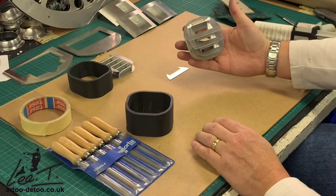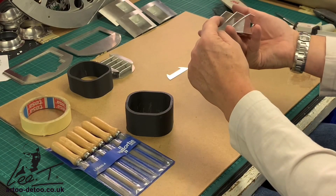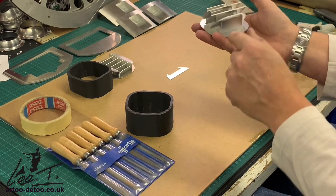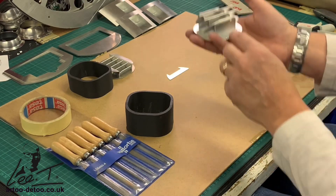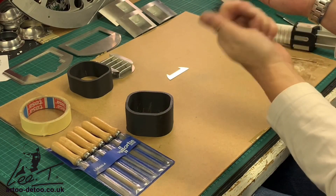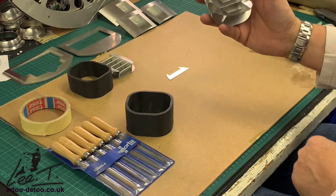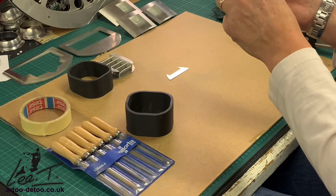So that's glued all together. And once that's done, you can glue behind these pieces which you don't see, and you can glue under here. Maybe put some masking tape across the top part to hold these in place. And if you glue into this underpiece here with masking tape on the other side, the glue won't ooze through and register from the front — the masking tape will stop it pushing through and give you a nice clean seal.